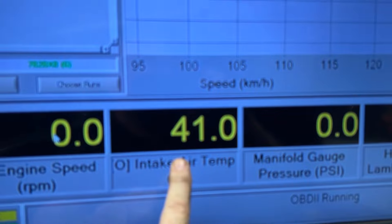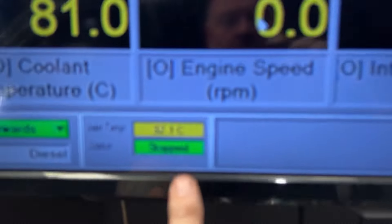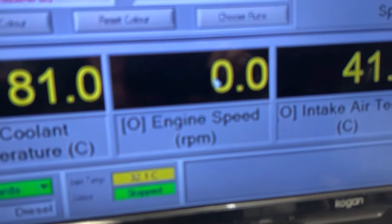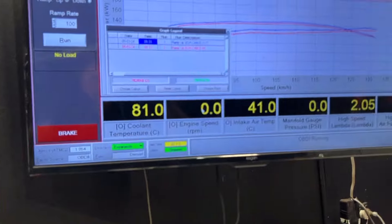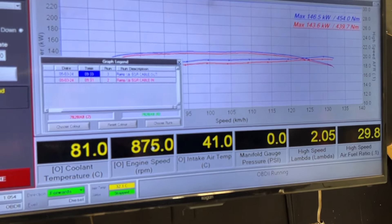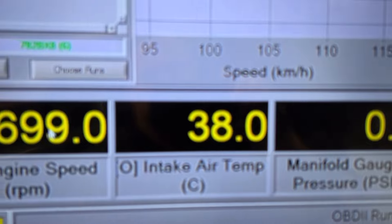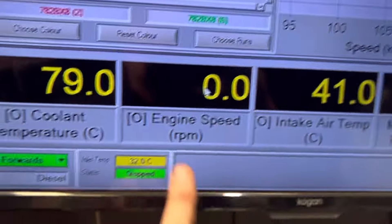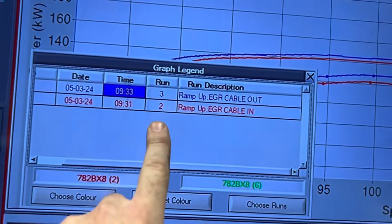You can see here our intake air temperature is 41 degrees — that's what's reading currently in the engine bay. And here we have, what's blurry as shit, but that's 32 point one degrees, sitting there. If I start the car up now, you'll see this air temp will start dropping down because there's airflow going through it — that'll drop back to probably ambient temperature. So you can see 32 degrees, 41 degrees not running.